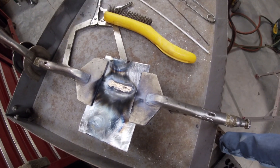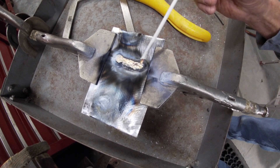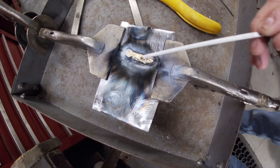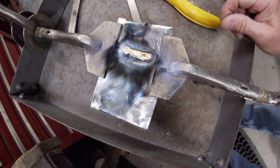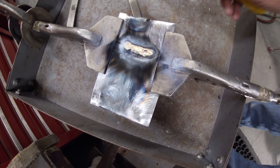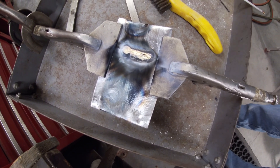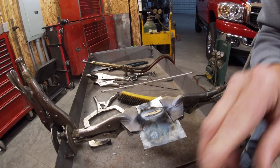As you can see, that just puddles in there — it flows in and it's kind of like a solder. One thing: Bondo doesn't stick real well on brass, so it always has to be ground down as much as you can. This top would all be ground off; you'd even grind a little bit back in here. Minimal brass exposed is what you want, and sometimes you just take a sandblaster and rough up the brass to help the Bondo stick. So I'm going to show you how we did plug welds.